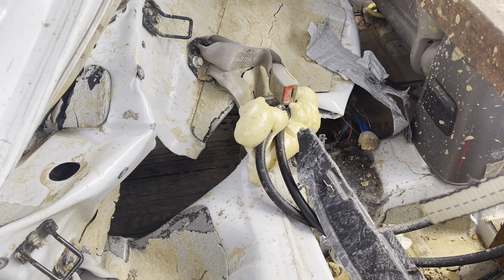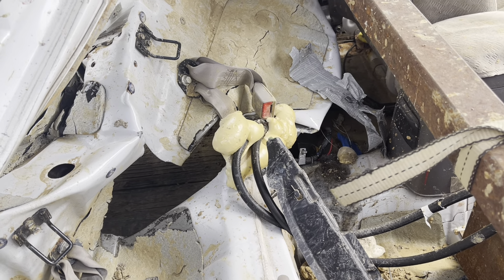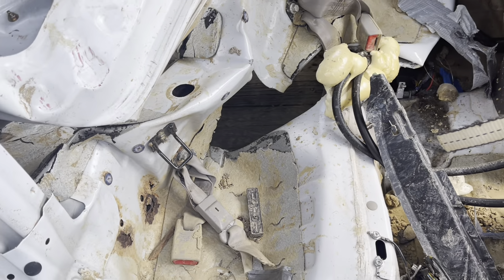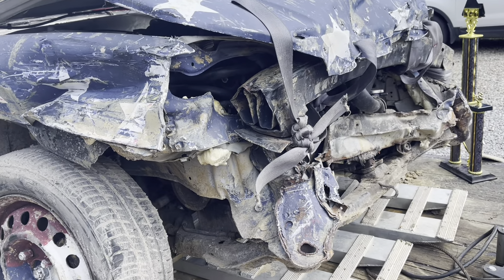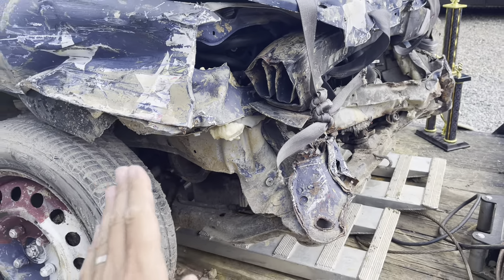You can see the carnage here and how close that rear axle got - I'll show the other side too. The biggest concern on top of that was the last shot I took where I said I can't risk it anymore, I gotta point the nose at them and send her as hard as I can. My fuel lines - if you watch my build video, I had this all open and pressed back, and it folded up and over to where it's slightly pinching the fuel lines. The foam spray absolutely did its work, but it was about to rupture.